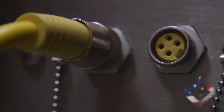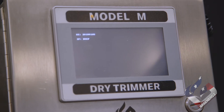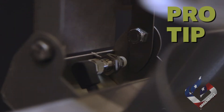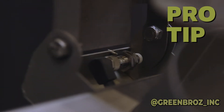The electrical box is mounted by a dovetail bracket — drop into position to secure. Plug in motor and sensor cables and reconnect your power supply. If you've successfully followed these reassembly steps and your Model M will not start, check the alignment of the lid sensor. While the lid is closed, the sensor light should have an amber light. The sensor can be adjusted to ensure proper alignment.